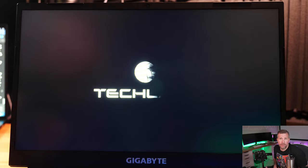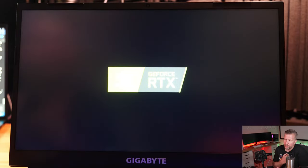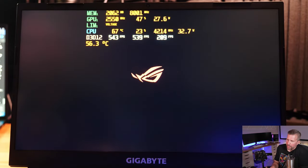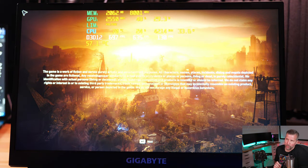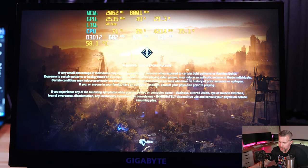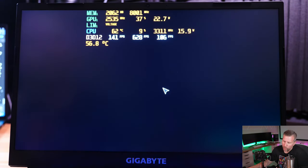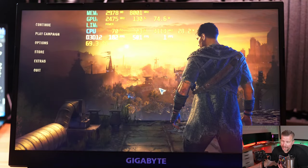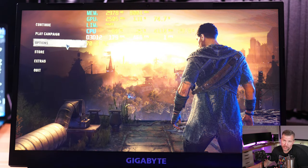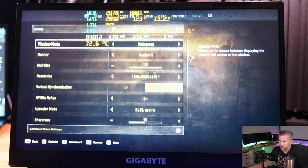iShowFace, if you're going to use an external monitor, you'd probably want to use a mini DisplayPort, and I think you'd be able to do QHD gaming, as long as you're willing to bring some settings down below ultra. Probably looking at medium to high settings in a lot of games. If you want to run all ultra settings, you're going to want either a higher-wattage 4060 or to go up to a 4070. And if you want 100 plus FPS on ultra settings in QHD, then you're going to want a 4080 or higher.